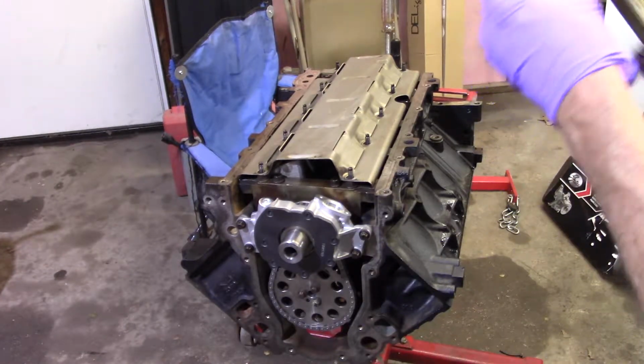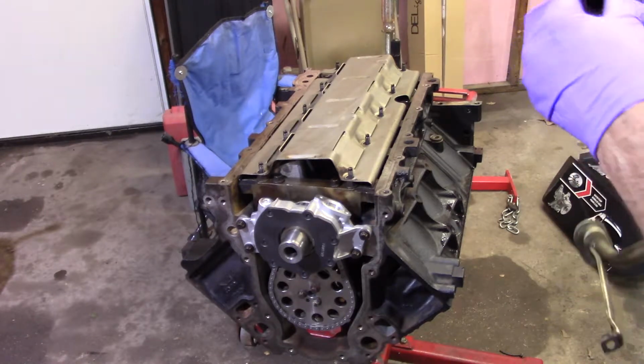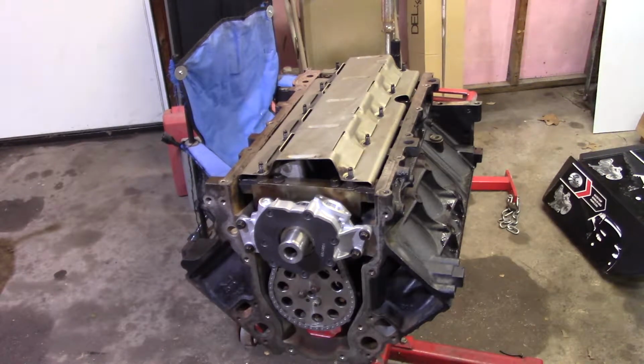I'm going to go ahead and put this O-ring on. And I'm going to oil it up. That you must do. Do not roll that O-ring or not get that in where it belongs. If you mess this up, the motor's going to crap out. It's going to do it. This thing has to fit in there proper, or you will not have oil pressure. At least not very much, if any, because it's going to suck air past that, especially once it gets a little low.